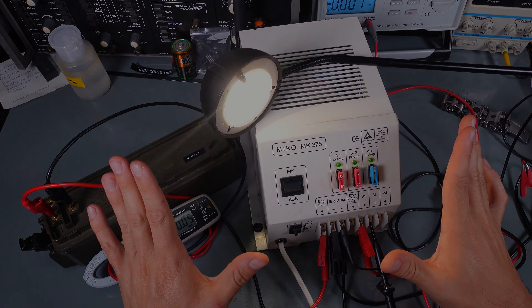I've added a clamp meter showing us power flowing from the battery into the unit, then from the output into the halogen lamp. Now the magic — I'm going to grab the plug and connect it into a regular AC socket. Something happened — you should be able to hear a click. What happened here is we are not pulling power from the battery, but the lamp is still working. This is the real magic: now the halogen lamp is being powered from the power supply. So when you park your caravan and plug it into AC power, all your equipment is magically switched to the power supply.